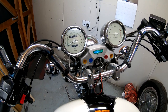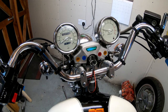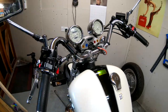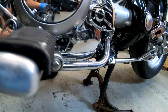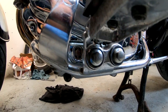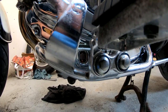Just start it up basically to prime the oil filter, and that's it really. Give it a little bit of a rev, then give it five to ten minutes to let the oil settle down, and we're going to check the level again. It looks empty now as you can see, but it's not really — so don't worry about it. I'm going to check it back in ten minutes.